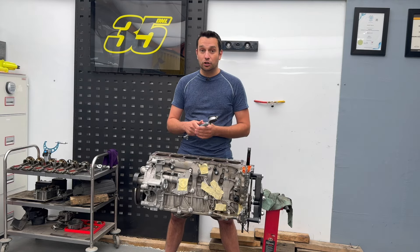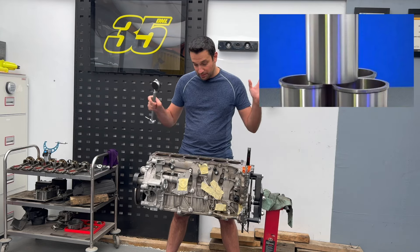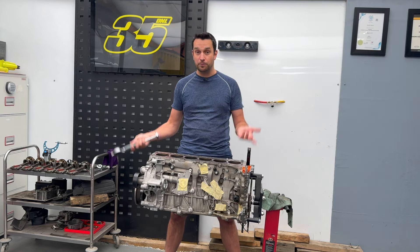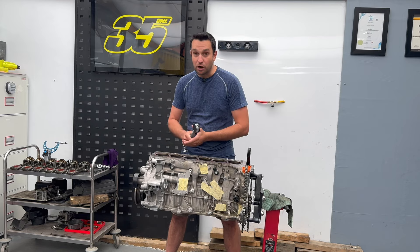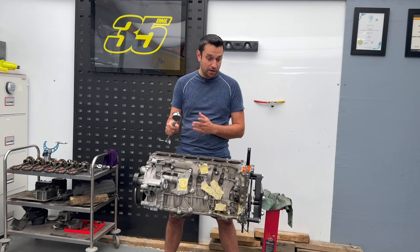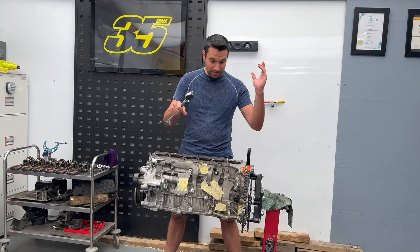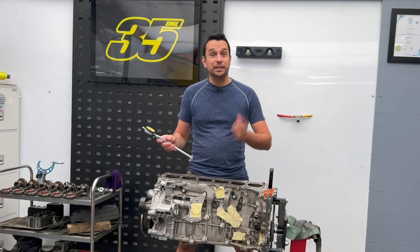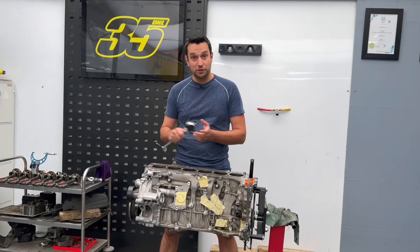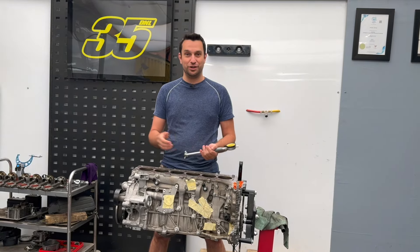Moving forward, what we're going to have to do is — actually my favorite thing — we're going to drop a set of sleeves into this block. I'm going to finish cleaning this out, take the crankshaft out, all the auxiliaries, everything, and send this block to the machine shop. They're going to sleeve the block — probably cast iron or steel sleeves, I'm not too sure. I'll have a chat with the owner and see which route he wants to go. But that means this block is going to be much stronger than it was from the factory. If you liked the video, hit the like button. If you want to follow up on the next couple of videos about the B58 rebuild, don't forget to subscribe. Thank you very much for watching and I'll see you guys next time.